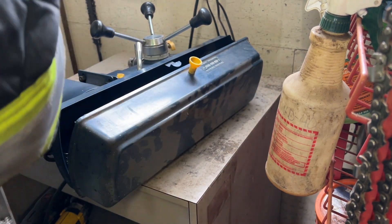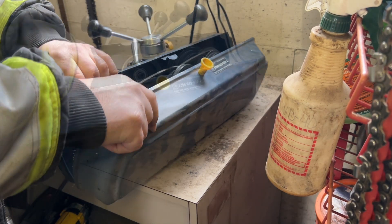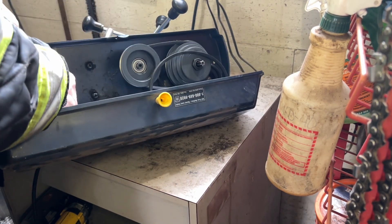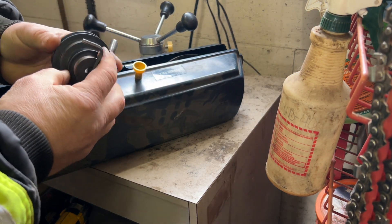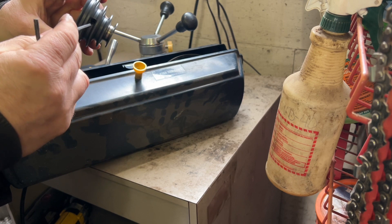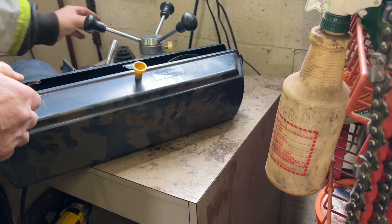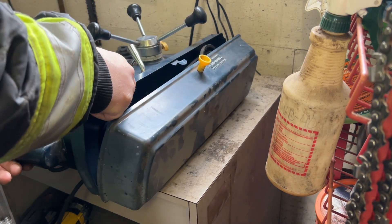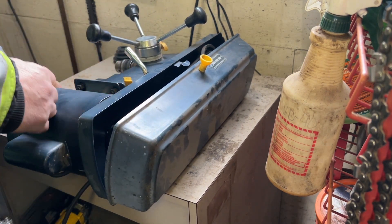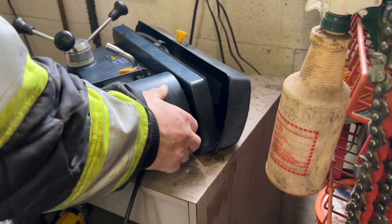There's a set screw on that pulley. What I'll do is take that off, take the belt off, undo that set screw. There's a set screw right here on this model. I should be able to take the motor out, the electric motor off. There are screws for the bolts.